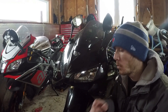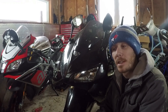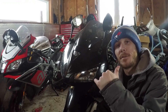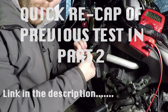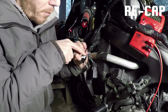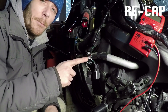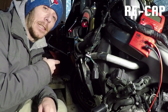What's up guys, so this is part 3 of troubleshooting having the fuel pump not priming on your CBR600RR. And as promised, this is testing the bank angle sensor, just like we stated in part 2. On the right hand side, you're going to see a solid black wire on the back, and a smaller red wire with a white stripe in front of it. The red and white wire is negative, and the solid black that is behind it is positive. So if we didn't have power to this, we would go directly to the bank angle sensor and test that.